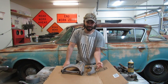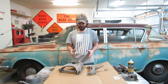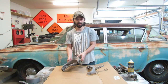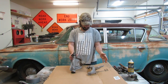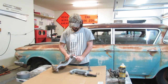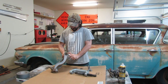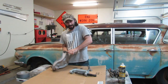Boy, that was brutal. Normally I love sandblasting, but that took me a couple of hours - it was kind of grueling. Ten hours in the vinegar just wasn't quite enough. It really helped, but it could really use another night or two. I'm actually regretting going about things this way. We should have just taken the bushings out first. The vinegar is amazing at removing rust, but paint and grease - not so much. Seems to not really do a whole lot for petroleum or oil-based products. Kind of feel like we're working backwards a little bit.